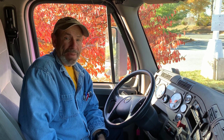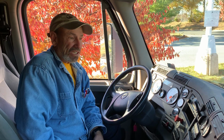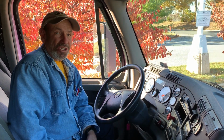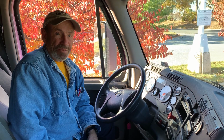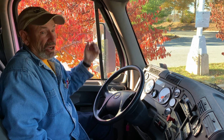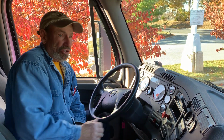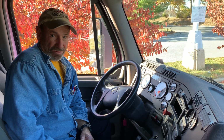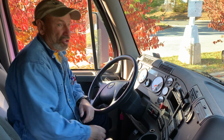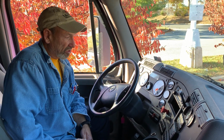Common mistakes made. On the in-cab, mistake number one, you just call out parts, but you need to show that every item in the in-cab works. Horn, air horn are working properly. If you do your heater, you must show that the heater works. You put your hand up top, put your hand on the bottom, show the defroster and the heater. You must show that every item works.